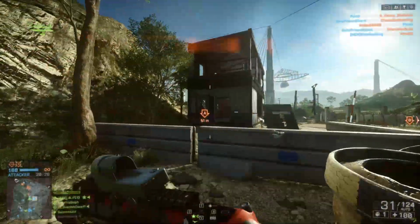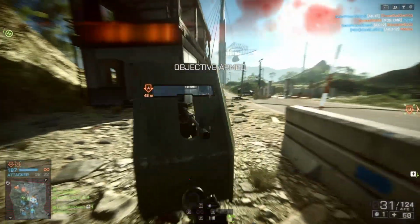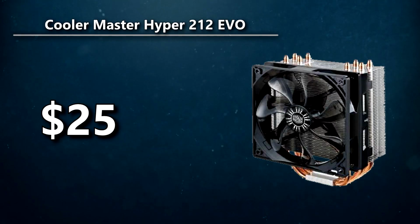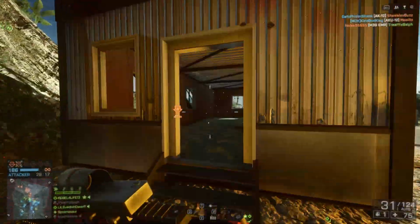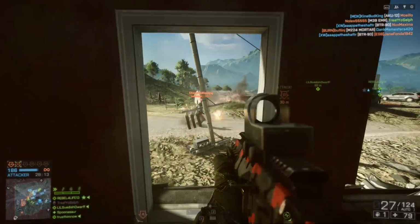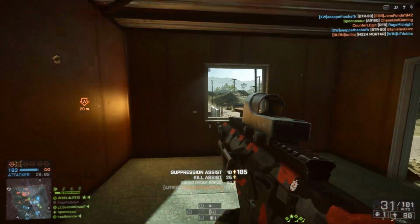If you're picking up a K-series i5, you're gonna want to overclock it, and you're gonna want a bit better of a CPU cooler than what would be a stock cooler. So at the very least, pick up something like a Cooler Master Hyper 212 EVO or a CryoRig H7. That's gonna do the trick pretty well. It's gonna let you overclock a little bit, but nothing crazy. But even if you slightly overclock the i5-6600K, man, this CPU is an absolute beast. And this paired with a GTX 1070 is gonna give you ridiculous gaming performance whether you're playing at 1080p or 1440p.